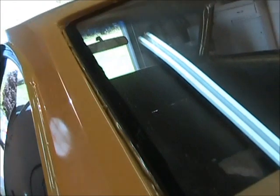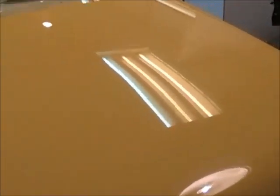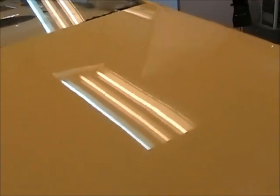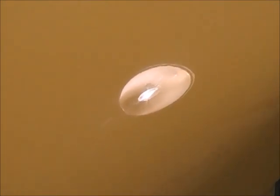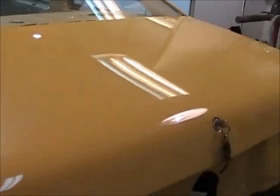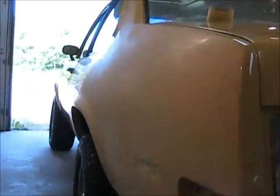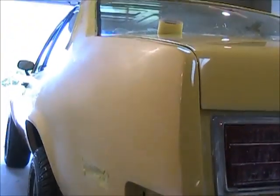You see here it's sanded and there's no orange peel and then it gets rougher - that's sanding right out. She's really coming out smooth. I did go over this with 2000 and buffed it with the McGuire's compound. Not quite happy with it but I'm going to try to get some finer sandpaper - some 2500 and 3000. Have to order it in because they don't stock it here in town. But the orange peel is gone, nice clear reflection. I'm going to try to get some of the Perfect-It compounds because I've been using the McGuire's and it's coming out nice but not quite as shiny as I'd like.